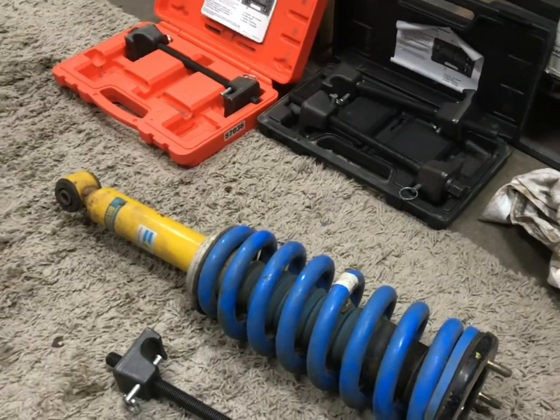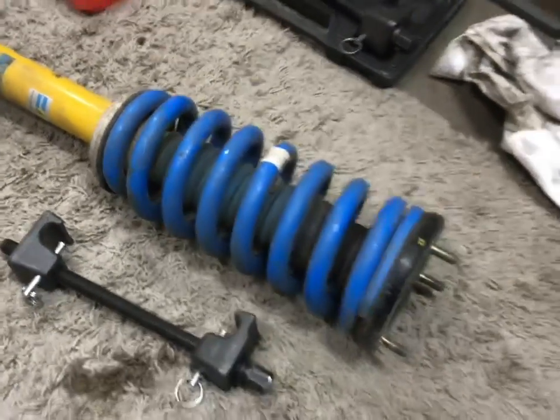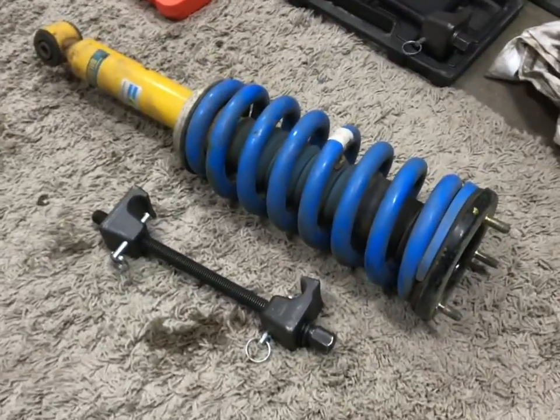Additionally, it's just an extra safety margin. I almost always use three of these, especially when working with heavy duty four-by-four springs. If this was like a Volkswagen Jetta spring, two would be totally fine.